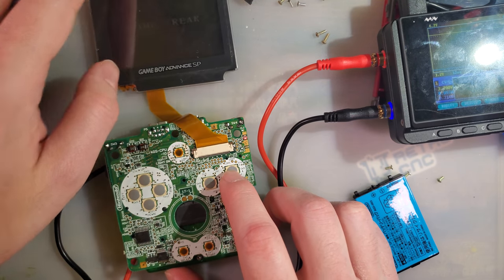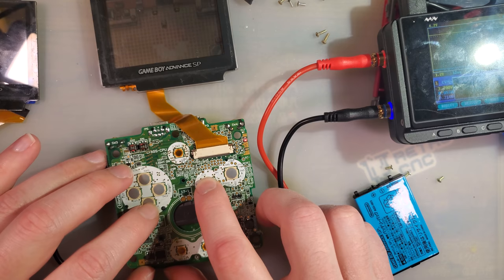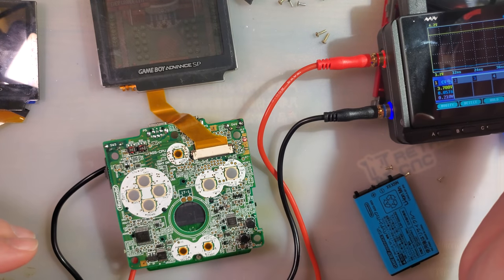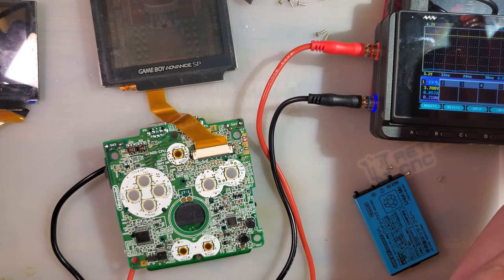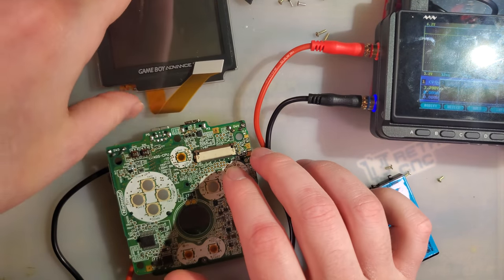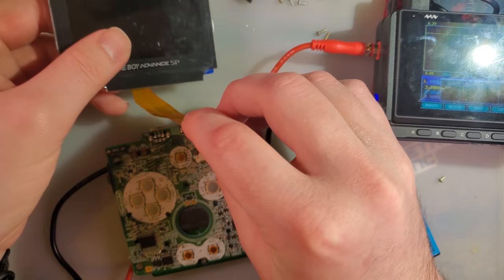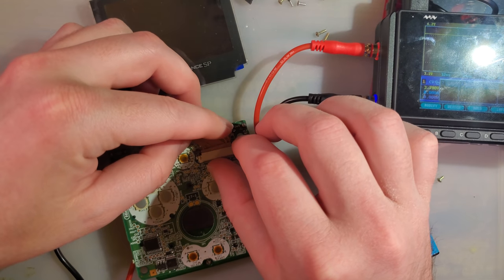The front light is on. So in the game, same place I pretty much always test. We are pulling at 3.7 volts, 52 to 57 milliamps. Swap out the screen here. Oop. Forgot those are not stuck together. Ooh, my ribbon looks pretty beat up. Hopefully it's okay.